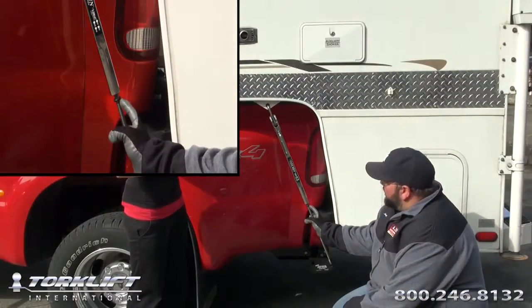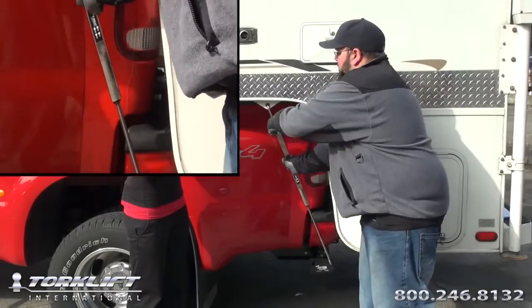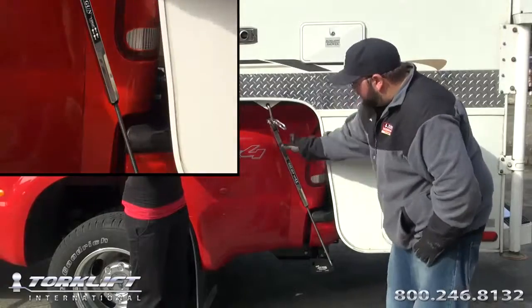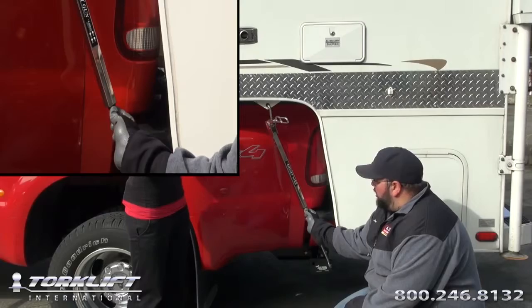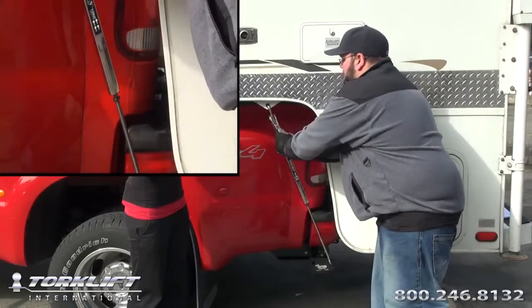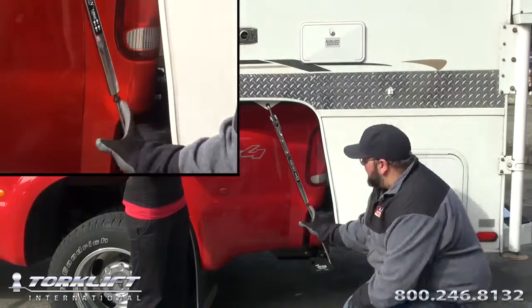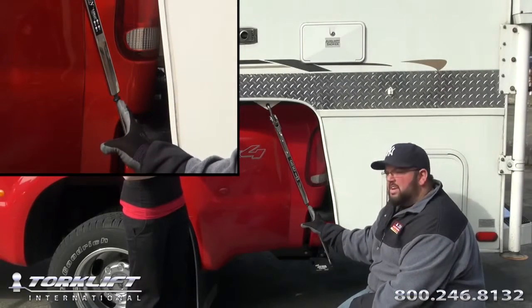Every fast gun comes with an O-ring located at the bottom of the body. First thing you're going to want to do, put the fast gun on your truck very loose, handle open. Second, you will want to push the O-ring to the bottom of the body, all the way so it's very snug. Then lock down your handle and see that it separates one quarter of an inch. This one quarter of an inch represents 300 pounds.